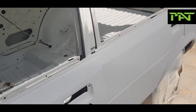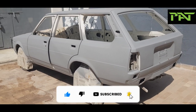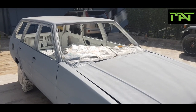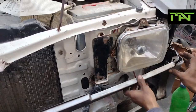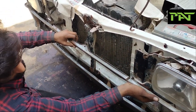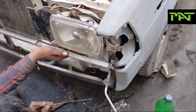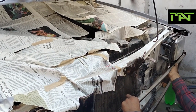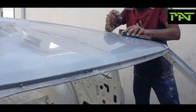With the cabin in ready condition, we will move on to the exterior of the car. The small adjustments, such as the front bumper shield, will be done now so that the rest of our work is complete. The important thing is that the front grille, headlamp brackets — everything is dry-fitted so that we don't have to make changes after painting.